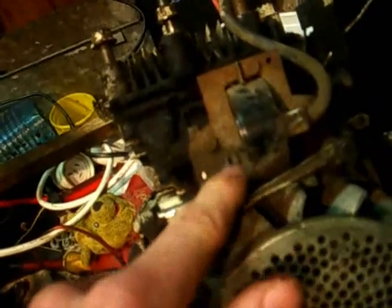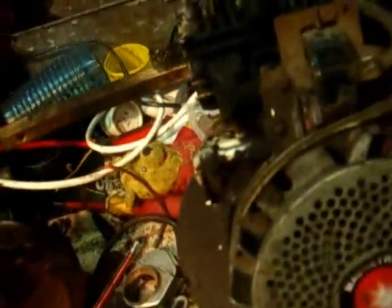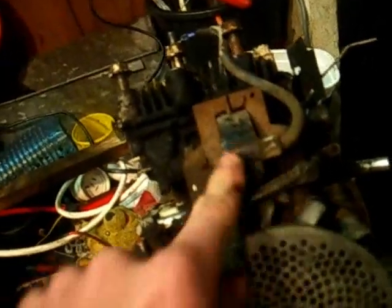Since there's no easy way to get the flywheel off, you can go to the mower shop and spend around $25–$40 on a kit that includes a plastic piece with a coil — your new electronic ignition module — which straps onto the side of the existing coil. The other option is to buy a second-hand coil that already has the complete module built in, which I'd recommend because it's just as cheap and just as effective.